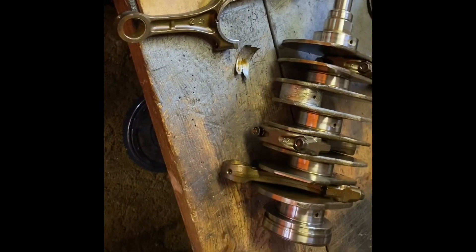So that is why you remove the banjo bolt filters. The guy I bought the car from said the owners ran it dry on oil, so that'll obviously do it too. I'm assuming the filter is still in there — this car had not super high miles, but it was like 120,000. If the filters were clogged, that definitely could have caused some oil starvation, which would make it a lot worse. So my friends, if you ever had a car that developed a rod knock and were curious what actually happened — what it looks like — now you've seen it. Specifically if you had a Subaru that developed it, it's actually pretty common.